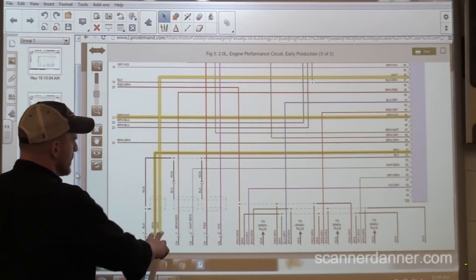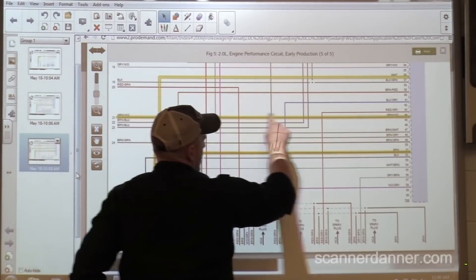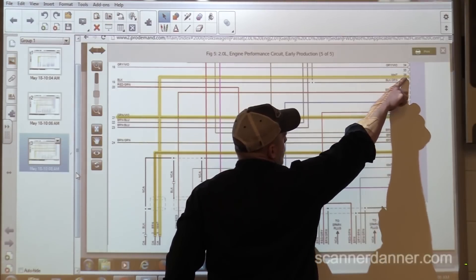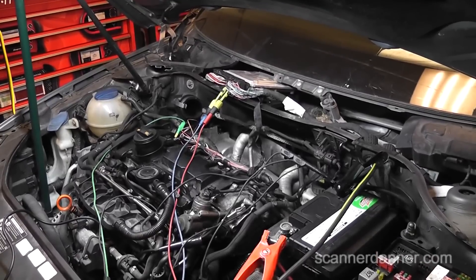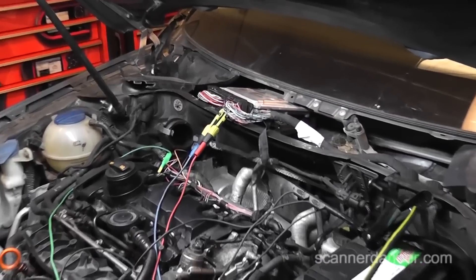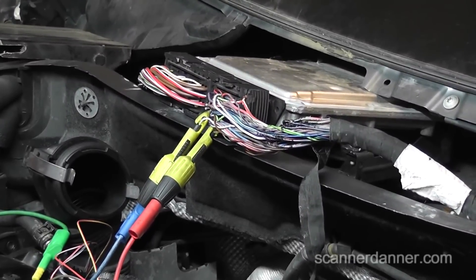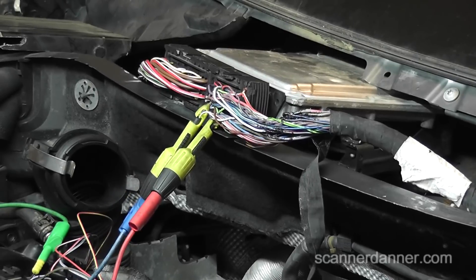I took a capture showing the two crank wires, and here is my cam sensor wire — green-violet — at computer pin 44, and we tapped in for the crank on pin 35. You can see on the computer itself where we are tapped in, and yes, we are poking holes — ones that we will fix when we're done, unlike the janky wire-piercing that the previous person was doing in here.